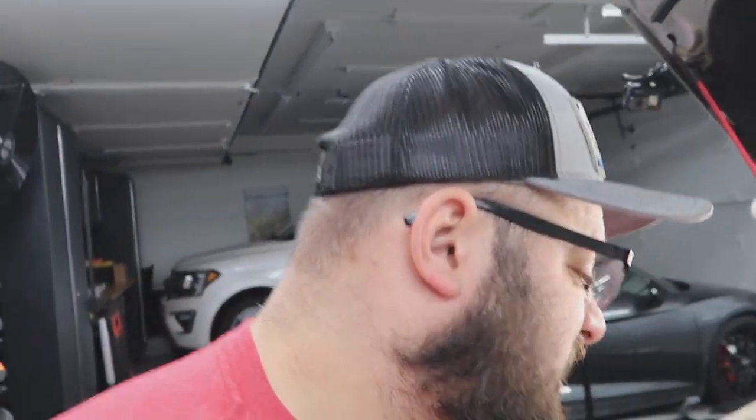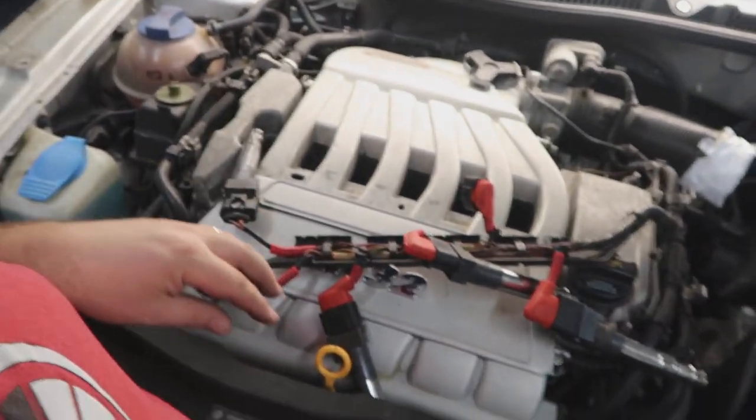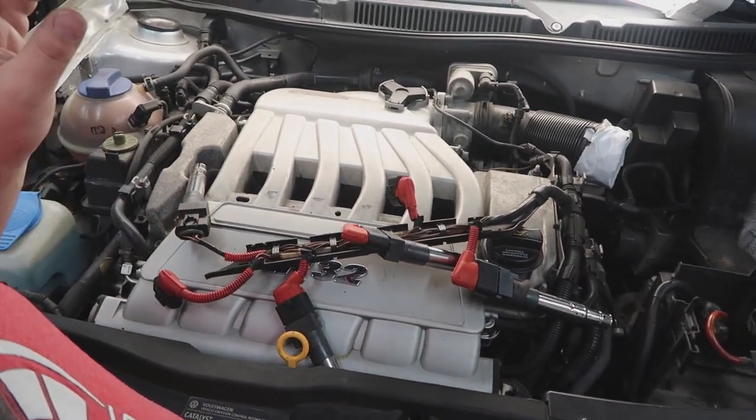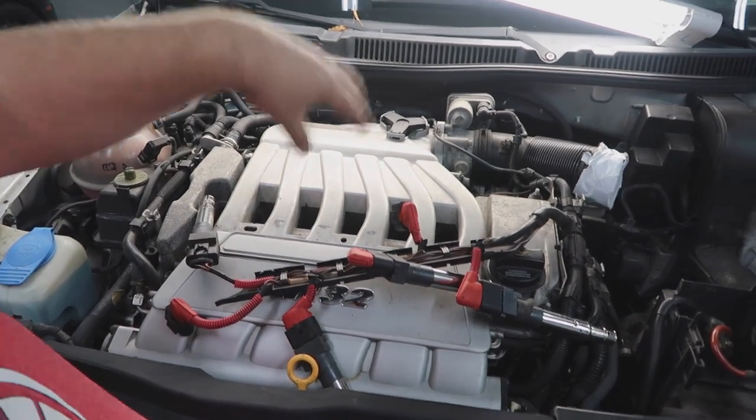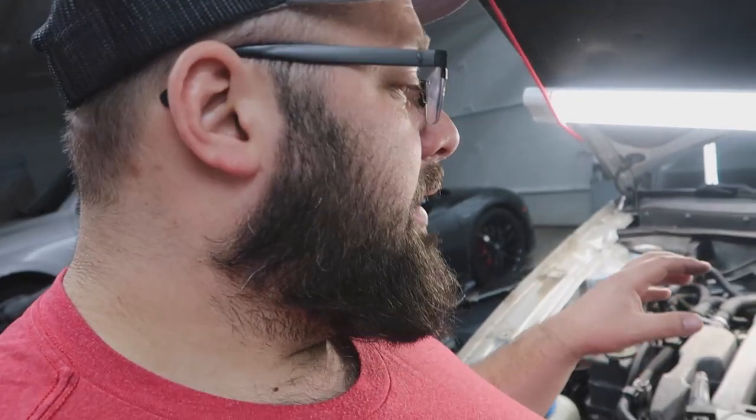But anyways, that's not gonna stop me today, because everything stops me whenever I work on my car. So what I'm gonna do is at least replace all the blue stuff, put all the coil packs in. I removed all the coil packs. I have new spark plugs, but I'd rather wait until I get the new coil packs to install the spark plugs. So I'm going to replace all the red with blue, and then I will put everything back together. Just not firm, because the coil packs are pushed in pretty good because they clamp under the plugs. And then I will move on to the short shifter. So let's do that.